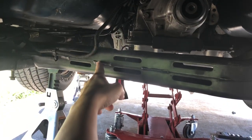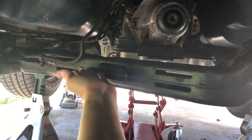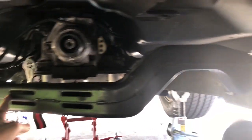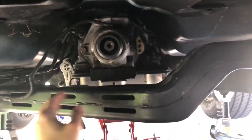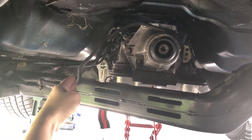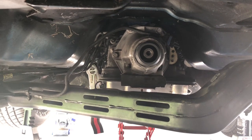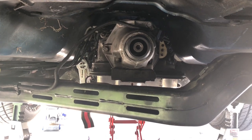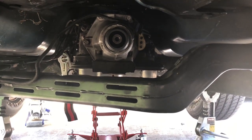Also, I think what I'm going to do is notch this out a bit right here. I'm going to probably cut that out just like this, cut that out, and then re-weld that up in there to give me a little bit more clearance for my exhaust coming out this side, because obviously this side has been clearanced. This one is not, and I'm going to have the dual exhaust. I may even use a little bit of flat bar steel to raise that section up and give me even more clearance for my exhaust. But what I'm going to do is just kind of chop it all up and start putting it in there the way I want and see how everything fits. So, follow me along, here we go.